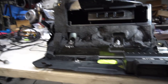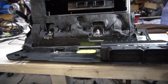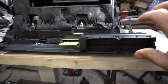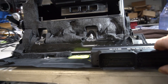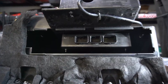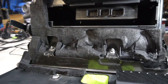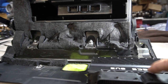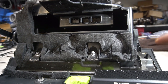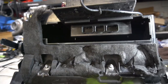Here's the adapter box underneath. I have a bracket that's not attached right now — once attached it makes this very rigid so it doesn't flop around, even though the plastic is very strong. The harness weight is fully eliminated with that bracket. We put the S7 ECU in the glove box, and what's great about these two locations being this distance apart is that we're able to reuse the existing adapter plug-and-play harness — no repinning, no reconfiguration needed, and it's very clean.